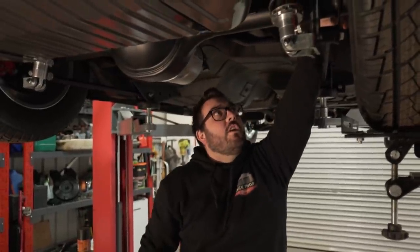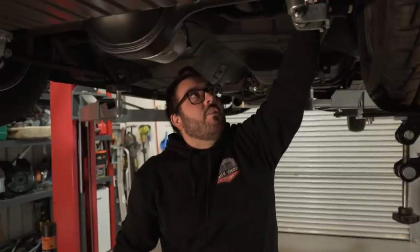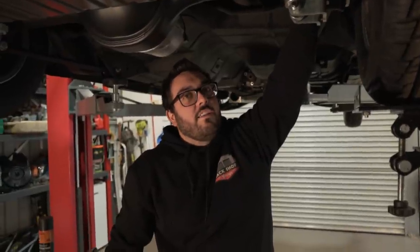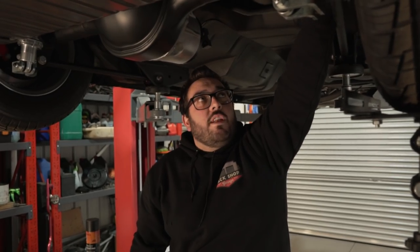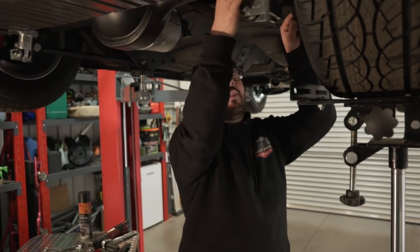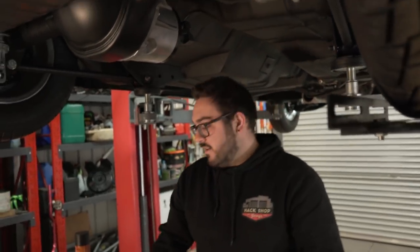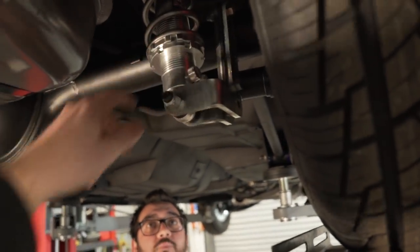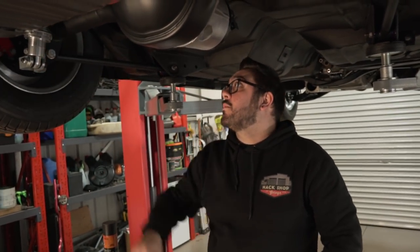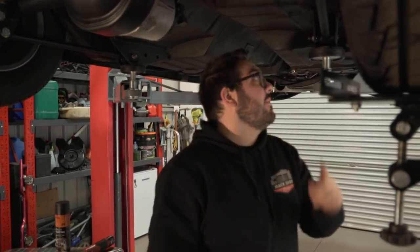We think this is the height we want — good ride height. The bump stops we have to cut in half; at the moment it's got full-length bump stops. I'm either going to cut these down or try to find shorter ones. Right now it's sitting on bumps, so we probably want to put some preload on them. We're going to play with the suspension once everything's in the car. The reason we haven't done this up yet is we keep forgetting to buy anti-seize, so they're just sitting in there for now.